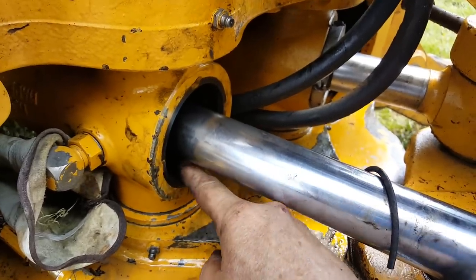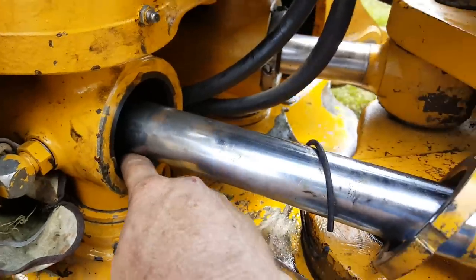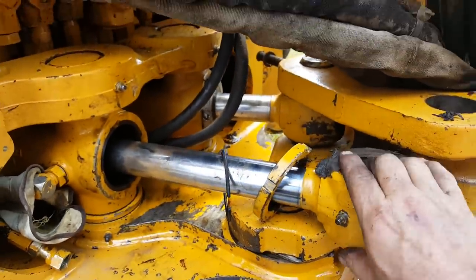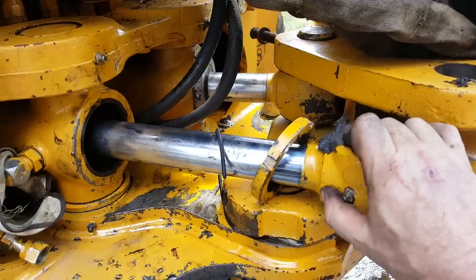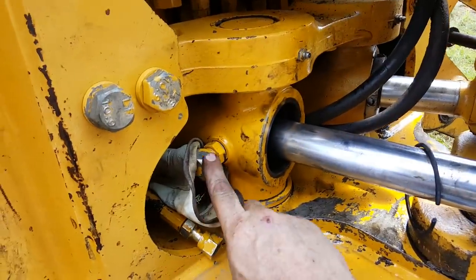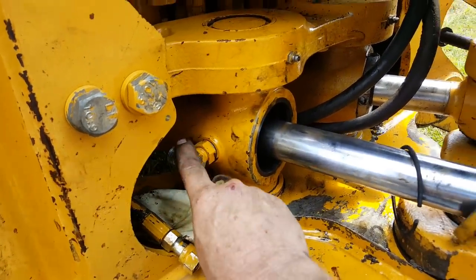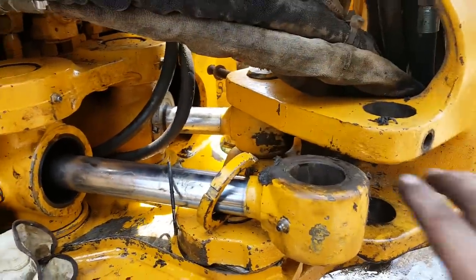Remember to put that little red plastic ring that comes with the kit into that slot. Get the two loose ends and put them in the slot, then work the rest around each way to get it nice and smooth all the way around. After that you proceed just like every other cylinder — pull this out. It's loose here so you're not pulling against fluid, and you have an air intake there.